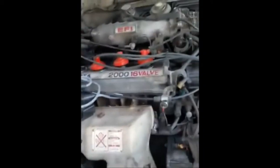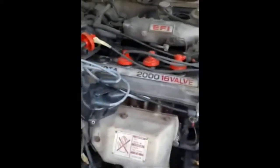One turn, two turns, maybe three - and that's all she wrote. I'm just about done replacing all four spark plugs, on the last one now. Quick note: whenever I take the old ones out and put the new ones in, I put the old boots back on top just like that. You don't have to push them all the way down, but it helps keep trash from going into that chamber.